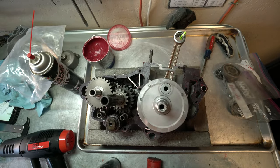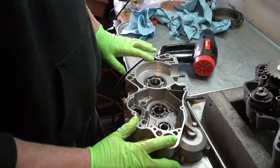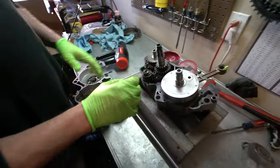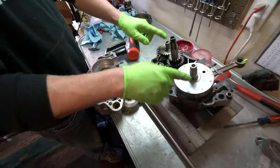Do you cut this after you press them together? Yeah — I'll put the case half on, we'll bolt it down, and then check the transmission. If all that checks out, then I cut it. Because if you cut it now and then have to pull this back apart, this holds the gasket in place where it needs to be. If you don't check first it can move and shift and be a real pain. So you always want to leave that on there and cut it last when you're absolutely sure everything's shifting properly. We're going to want to heat all these bearings up — it'll make this a lot easier. When I heat this up and put this on, just like the crankshaft and transmission, I want it to just slide in — I shouldn't have to beat on it.